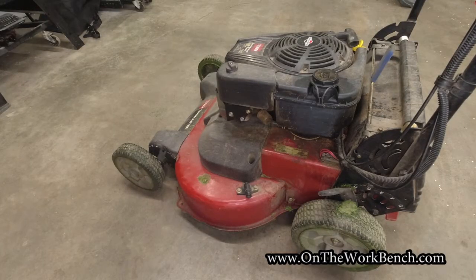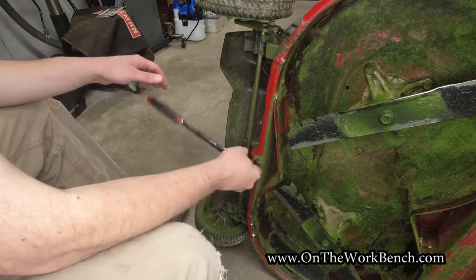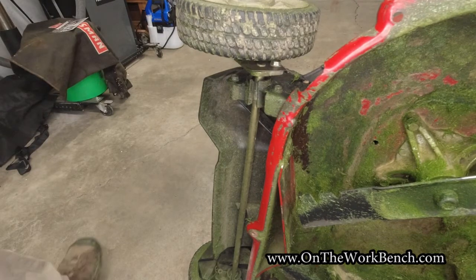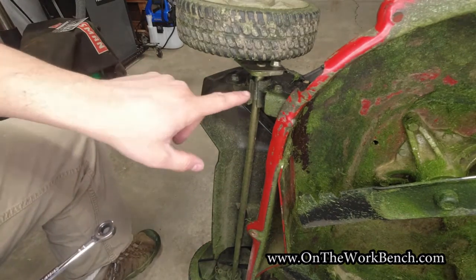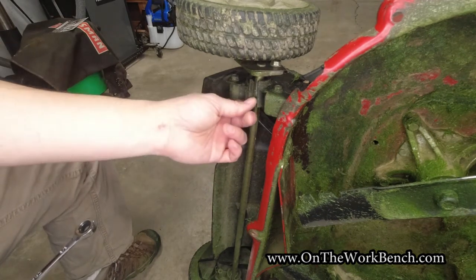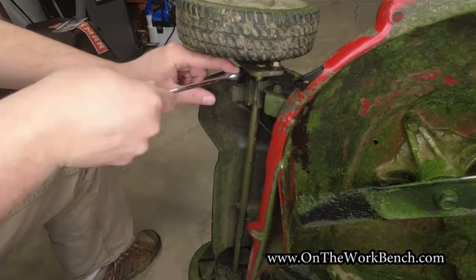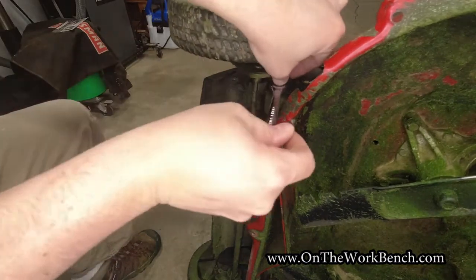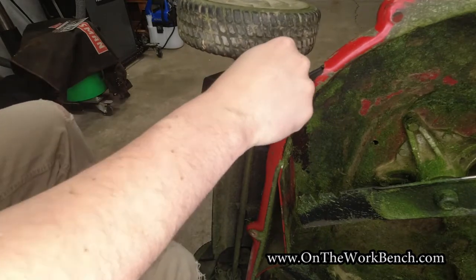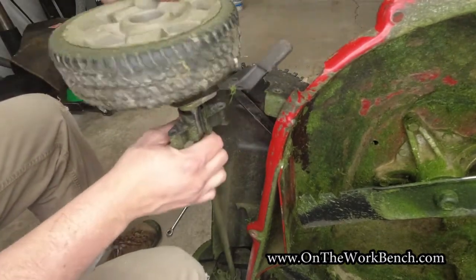The first thing we're going to do is flip this mower on its back so we can remove the front shroud over the axle for easier access. We'll use a three-eighths socket to remove the bolt holding that front shroud. While the axle is still in place, we've removed one of the pinch points so we can get that off. Then there are two little bolts right here that we need to remove — they hold the carrier assembly that moves up and down within the bracket. That's done with a three-eighths ratcheting wrench.